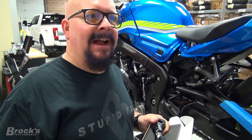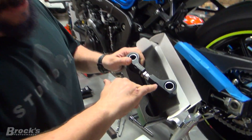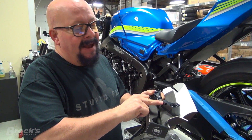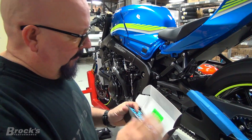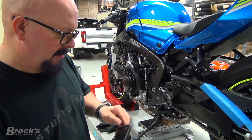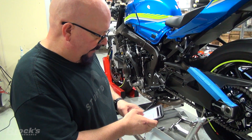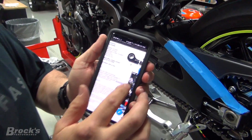We created this window - Brock's Performance Design. If you can see threads in the window, you know you have plenty of engagement, because that means you'll have one and a half times the diameter, which is as strong as the rod itself. We're going to put this on using our instructions - I'm going to grab my phone, go to my barcode scanner, scan the QR code, and that brings you to our installation page. Gixxer 1000, 09-18. Window link installation instructions - you pull up those and you get full blown window link instructions.